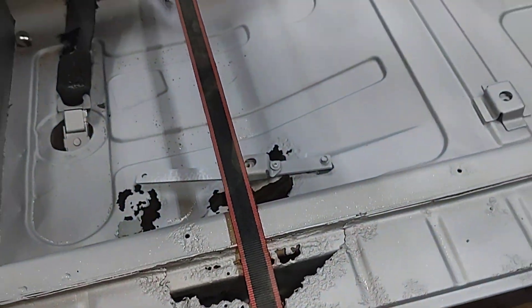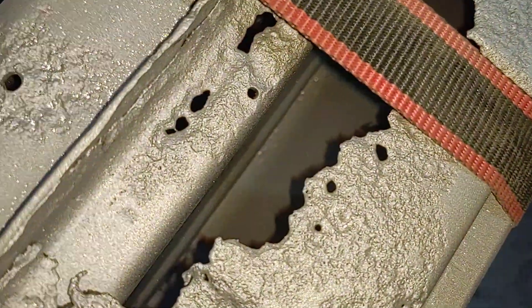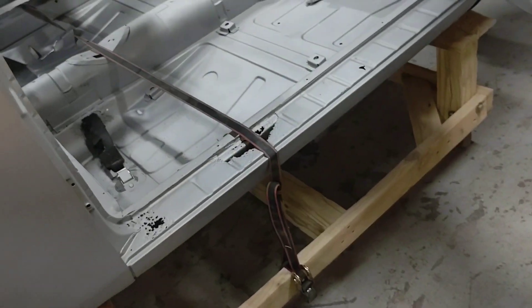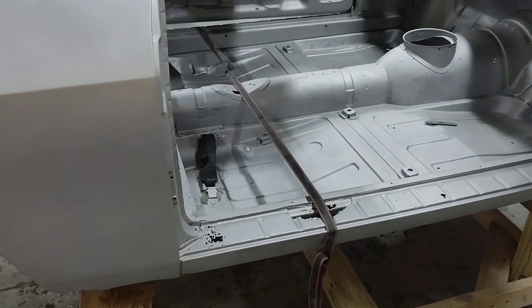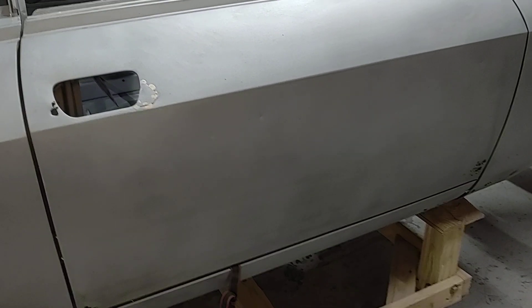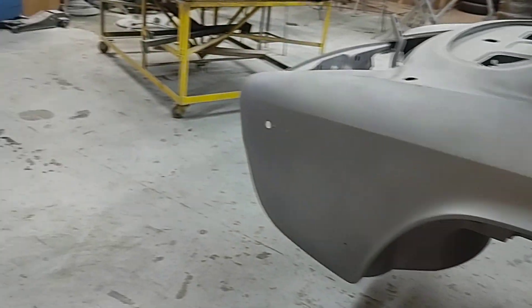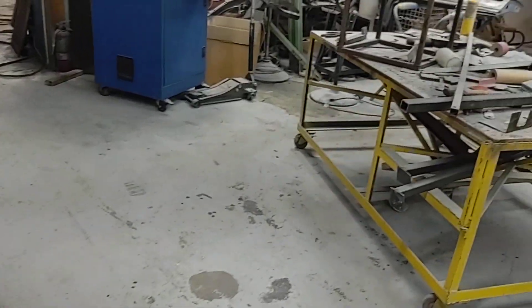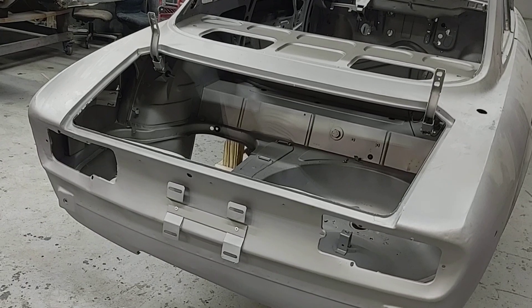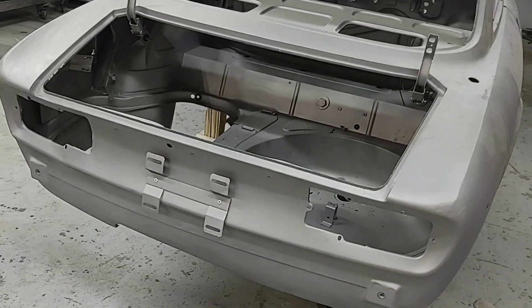I can't really see what's going on in there, but from experience I'm pretty confident the middle rocker is going to be okay. You can see some rust in there, but that'll be dealt with when we replace the outer rockers. If there's anything on the middle rockers we can patch that without having to buy new middle rockers, because obviously we can make it structurally good without replacing them since they're not visible. So we don't have to go to great lengths.